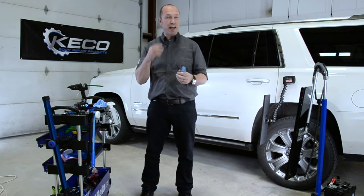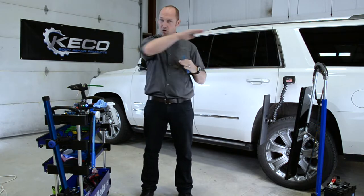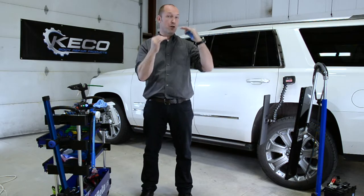We will be explaining why, but every dent has a high spot and a low spot when you start. It's never only flat with a dent. You want to correct lows, but you want to knock down highs.